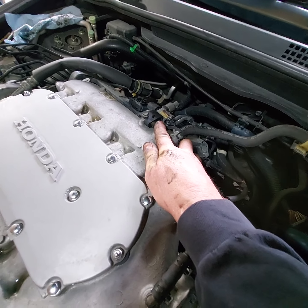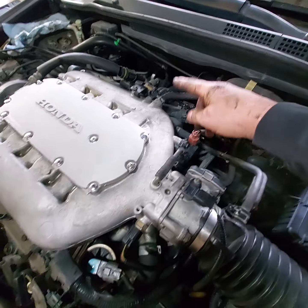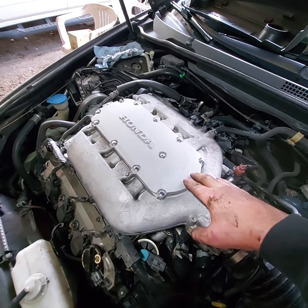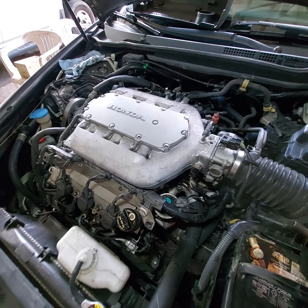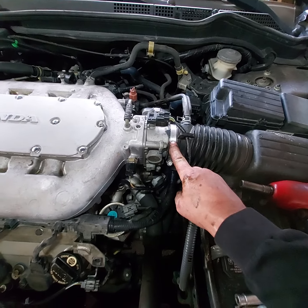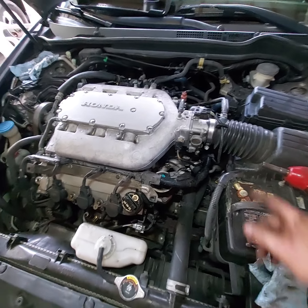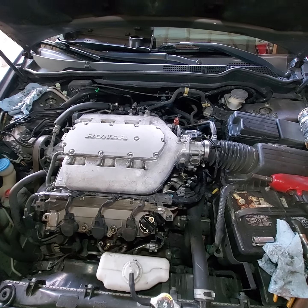Got that connected, and the vacuum line for the brake booster is on. These 10-millimeter head bolts are all tight — they're not head bolts, so just tighten them and maybe a quarter turn will get that top cover on. Don't forget to tighten your clamp on your air intake, and when you put it on, make sure it doesn't fold over — that it's completely all the way around up on the throttle body. A lot of people do that and suck dirty air in, and if you've got a mass airflow sensor in there, it'll read incorrectly and you'll get an engine code.